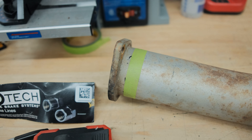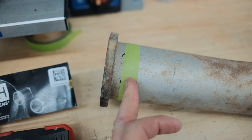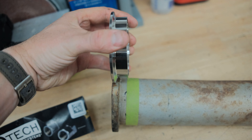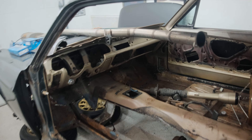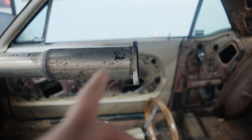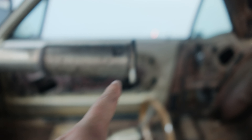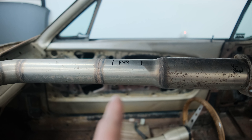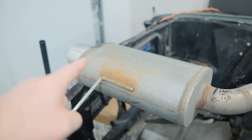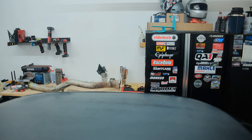So we're back — we're going to V-band this downpipe and work on the exhaust. I measured my line here, this is where I'm going to cut directly on the edge of this tape line, and that will be where our V-band clamp will line up and where we'll weld to on the main part of the exhaust right there. I'm going to put a V-band here, we're going to section in a flex joint there, throw a resonator on there, and then we're going to chop this muffler off. We have a cool dual tip exhaust tip over there. I'm going to get right to it and start cutting — let's start making this exhaust.